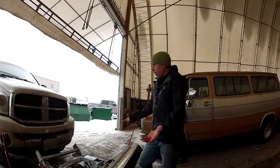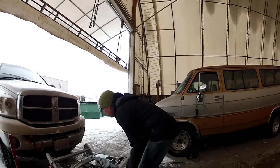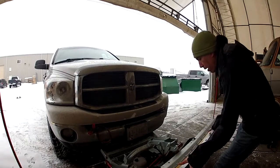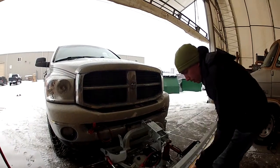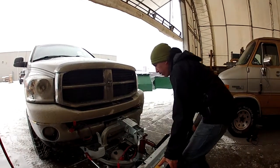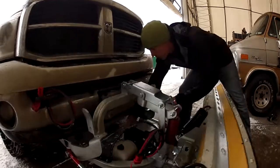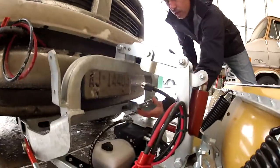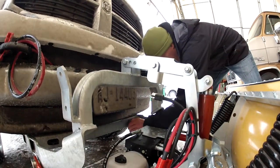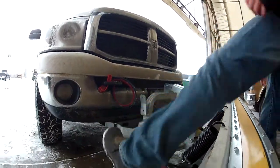We're going to do a step-by-step. Basically, you have your plow in front of your vehicle. If you maneuver it so that the crossbar lines up with your lower A-frame bar, and then push down on the blade, you can rotate that front frame up and slide it onto the vehicle. Once that's on, the T-shaped clips — the tab, the form tab and cable — go underneath your crossbar or the front frame and drop onto the mushroom-shaped or T-shaped piece on the crossbar.